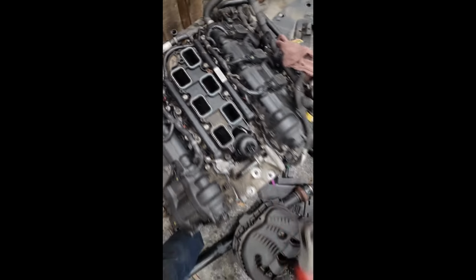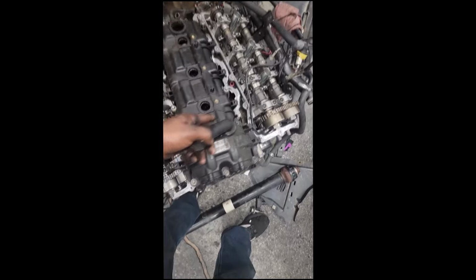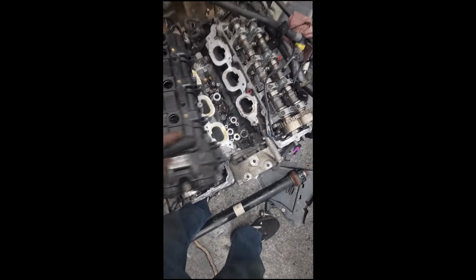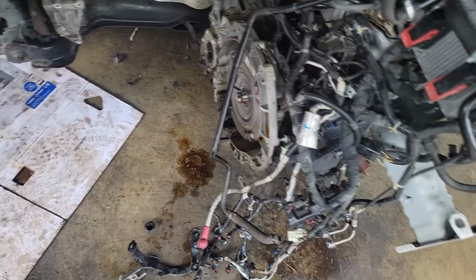I'm gonna save you some money, but they overheated it. So technically everything attached to this engine, this plastic, needs to be replaced. So now I'm back to get the valve covers off. Even the damn wiring harness for the NOx sensor. So I'm gonna use that on this. My buddy got lucky. This thing right here by itself is expensive. All right, so we're gonna do it that way. Yeah, I'm trying to help him out because we want to get this going, rolling, and everything.